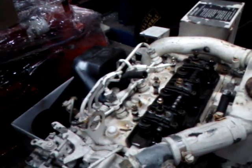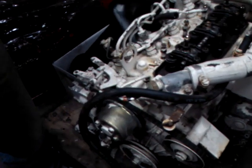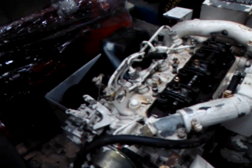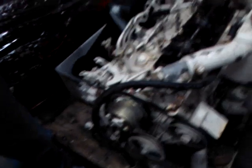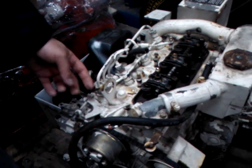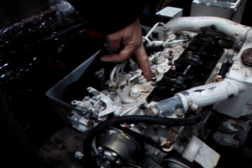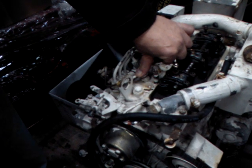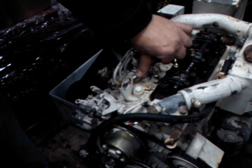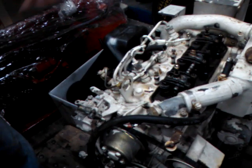How do you set the position to be in the right spots? Yeah, as you move the engine around, you'll see how they come up. Most of all, if you want to start at top dead center — how do you tell you're at top dead center? Easiest way I've done it before would be just to take out this injector here, put your thumb over the hole, and you'll feel it as it comes up — it'll be like a little big compression stroke, it'll almost push your thumb right off. That's your top dead center.